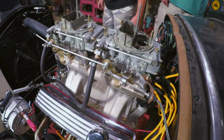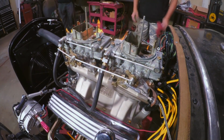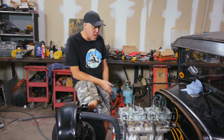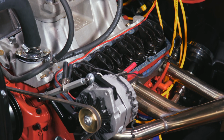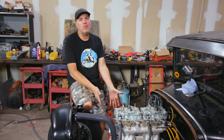We have to change the cylinder heads on this thing. We tried to fire it up again and you saw that it was just completely flame on, exactly the same as before, and we verified timing, everything. The problem is that those valves are still sticking. Even after I pounded them and got compression back, now that it's rotating over naturally, I've got zero compression again.